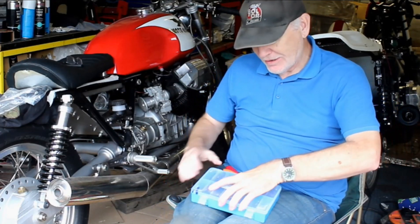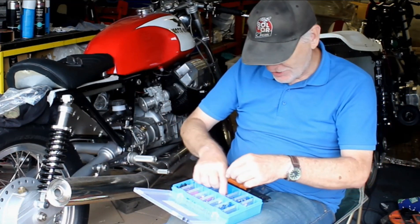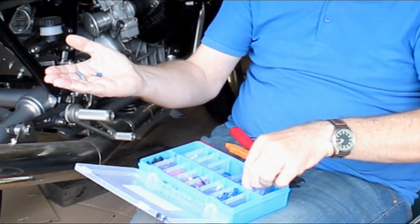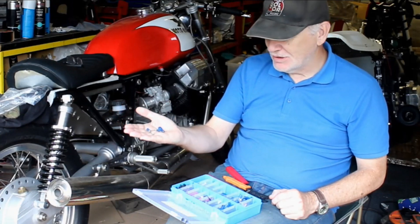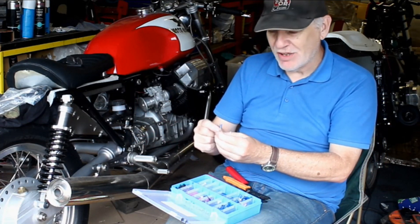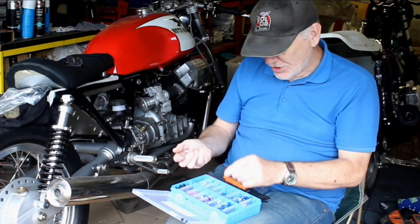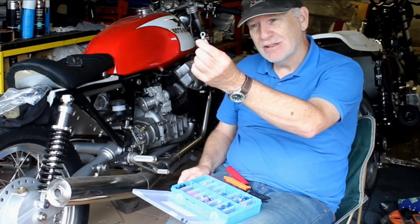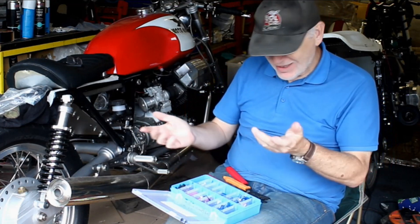What I don't recommend are these so-called insulated terminals — the ones with the hard blue and red plastic covers. Frankly, they're awful. They're quite fat, and when you clamp them the plastic collapses so you're not sure if you've got the correct pressure. They're not even well insulated because water can get in. The only thing I do use them for is the little circular hooped connectors — I pull off the blue covering, add my own covering, and use it as a bare connector.